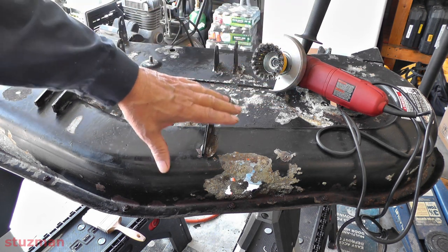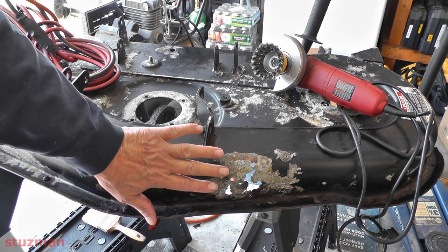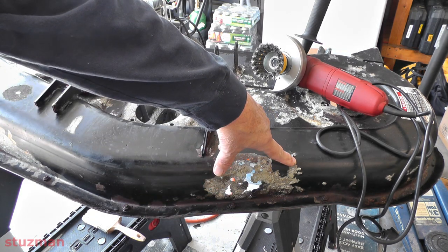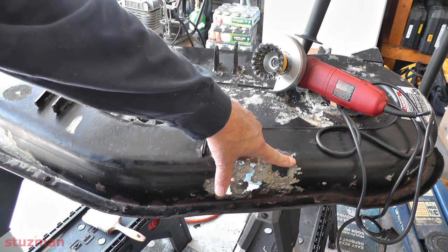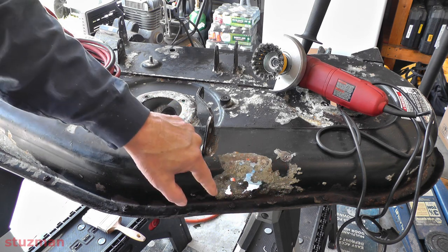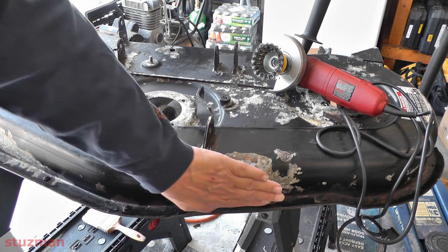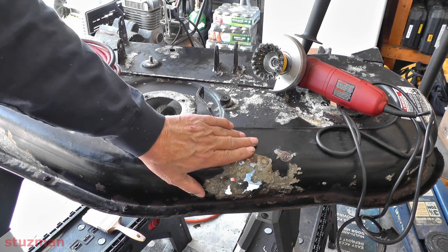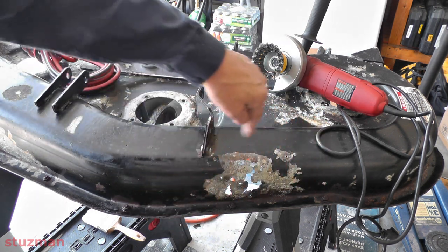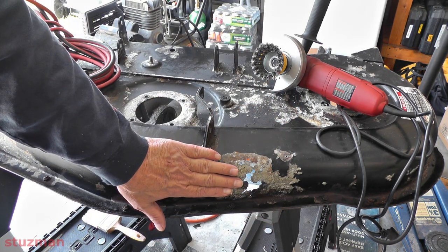But the most important thing is that I've got some rot out here. My thought is that I'm going to put a steel plate on here. This area measures about a hundred and ten thousandths thick, and I have a one-eighth inch thick plate. So my idea is I'm going to clamp it here, mark it out, heat it up with a torch, and try to form this around here to follow the contour. Then I'll come back, mark it, cut it out with a grinder, and weld that plate back in.